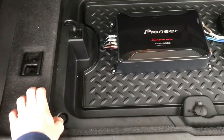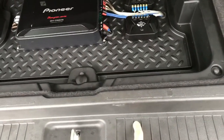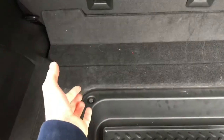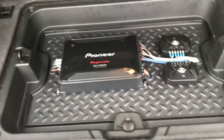This panel that bends up and down — just give it a tug straight up. There are like four or five clips that go across and it comes out really easily. Once that's out, you've got all the panels in the back out and can remove the actual entire cargo bin. The cargo bin is held in with bolts underneath. Take out those bolts and start lifting it up — when you lift it, pull out towards you because they're held in place by little hooks that kind of hook underneath. There are no clips — it just slides out and you can pull it out of the trunk entirely.